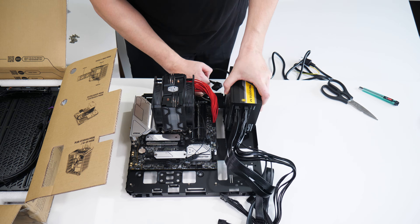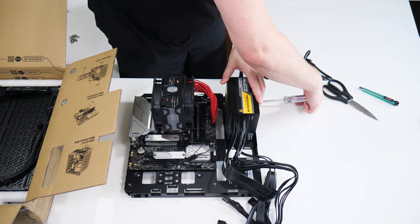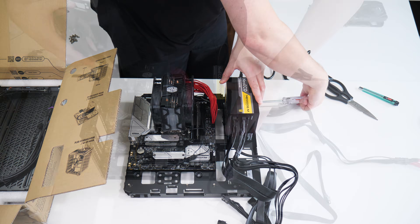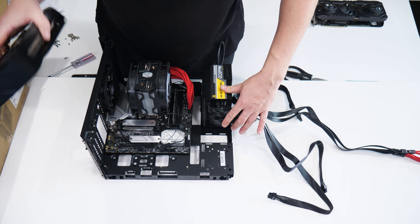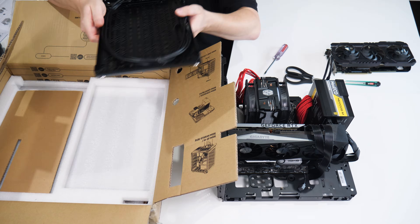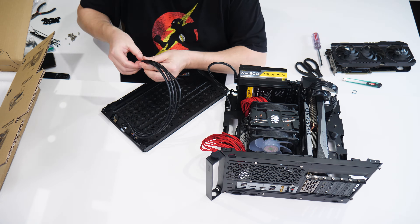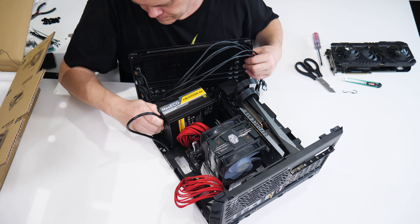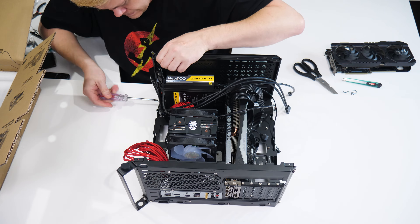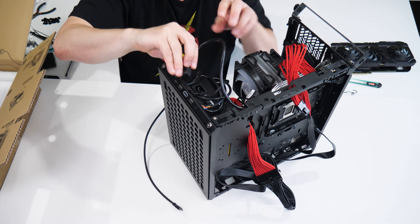Unless using ITX, a bottom mounted PSU can't occupy the same area as a motherboard. Fitting your PSU with an ATX board, try the front top location in the highest spot. A standard length 141mm Antec Neo-Eco 1000GM barely fits the GPU. The modular connectors have fairly sharp bends to clear the 320mm long Gigabyte 3070 Ti. We also tried the ASUS 3070 at 300mm which has an easier time fitting. After you lift up the zip-tied cabling, you can fit on the front panel. After a bit of test fitting, I cut the zip ties and freed the end to make it easier. For the leftmost Type-C port lead, I pulled out the power to the PSU. I accidentally did the two body locking screws, but there are actually four front screws.